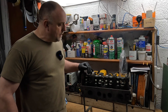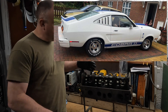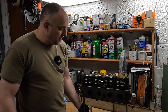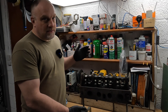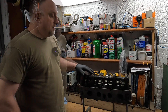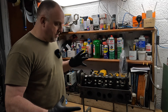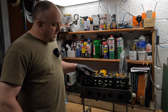He has a 77 Cobra 2 Mustang - I'll show you a picture up on the side. His car is down for a bit. It's a Cobra 2 but it's still a four-cylinder version. Over here in England that's a big deal - they're still maintaining four cylinders. They kind of like their Pinto engines. It's a box stock 2.3 with a little carburetor, he's got a header on it, and we're in the process of converting it from his four speed to a T5, getting rid of the tiny axle and putting an eight-inch in it with traction lock.